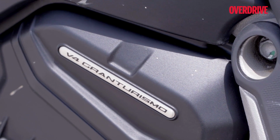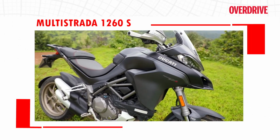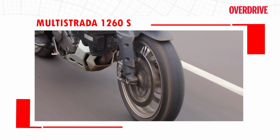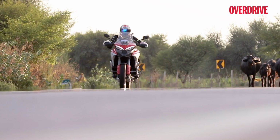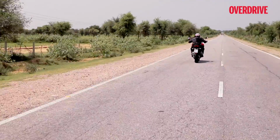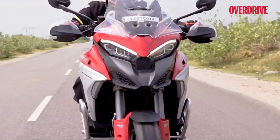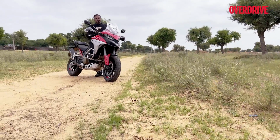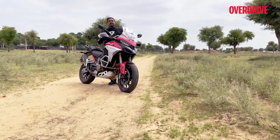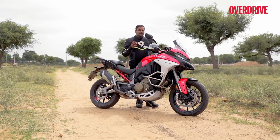The Gran Turismo V4 is more compact than its sibling in the Panigale V4. And though it's down on torque and displacement over the Multistrada 1260, it makes up with more power and extra cylinders, and it feels more manic. It also does without the desmodromic valve train and goes with conventional valve springs instead. The advantage is fewer valve clearance checks and in turn significantly longer service intervals, which on a touring machine of this kind makes a big deal.